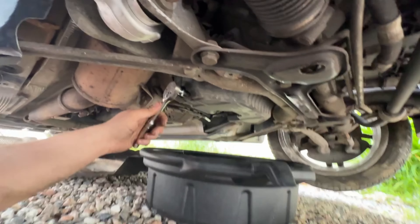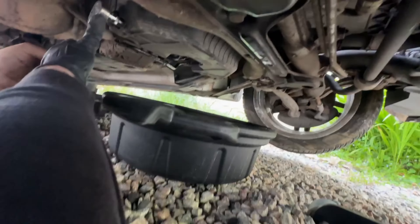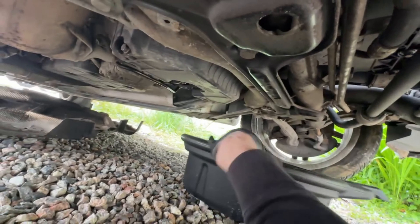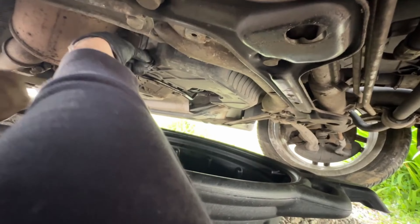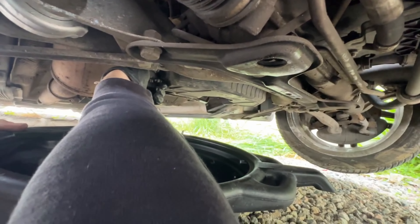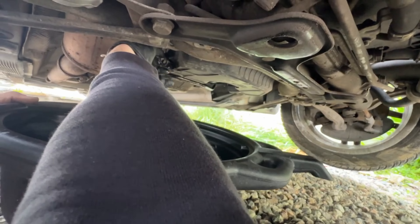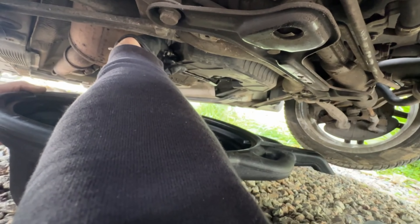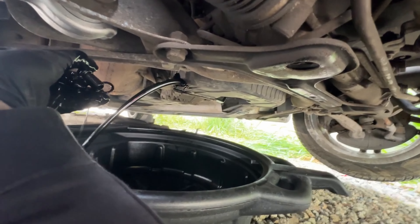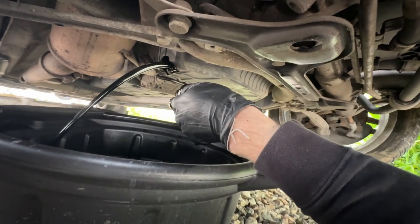It's tight — great work on your knees by the way, guys. Okay, now I've got it. Just take this out. There's a washer there I want to get off as well. We've got a nylon/rubber crush washer. Oil's pretty black but it is a diesel. Put my whole hand in the bucket trying to catch it — there's so much oil. We'll let that drain out and clean up. It's about 6.5 liters I think.